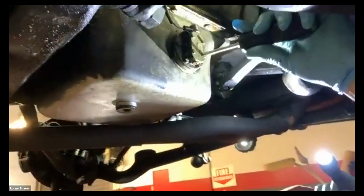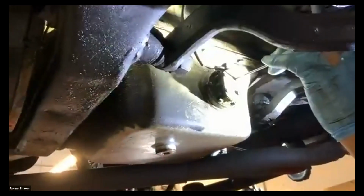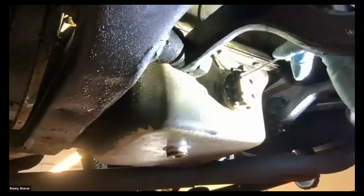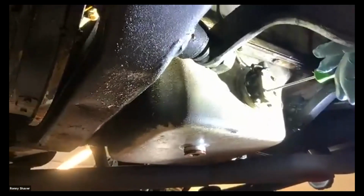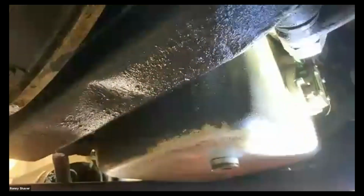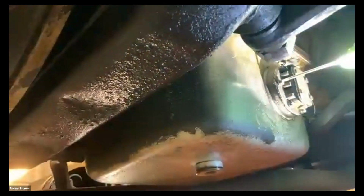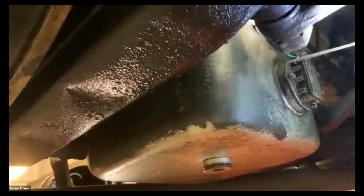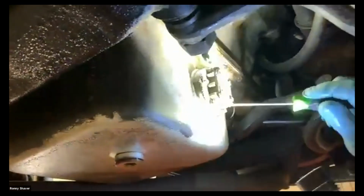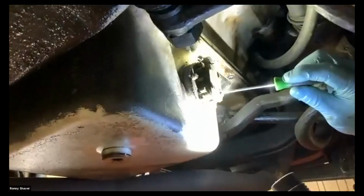And these little screws like to loosen up. So these are small screws. I can't see. There we go. Just add a little squish on them. And then this outer part, if you look at this thing, you can see it's kind of wavy. It's not square, the edge of this. And that's just time, it's pot metal. And just tighten this one. There we go. Just a little squish on them. And that'll help minimize oil leaks. So these are real common places for them to leak.